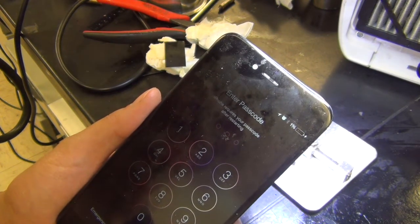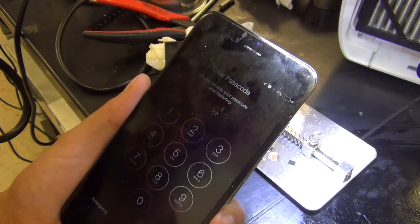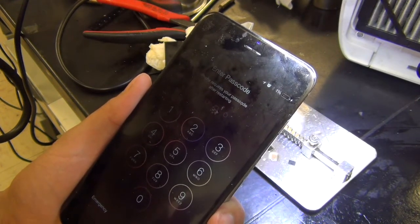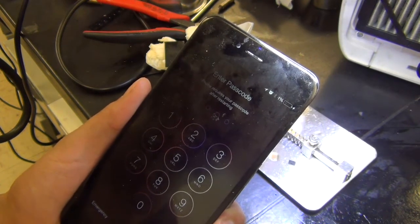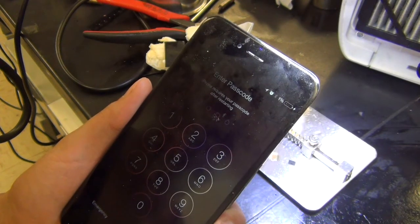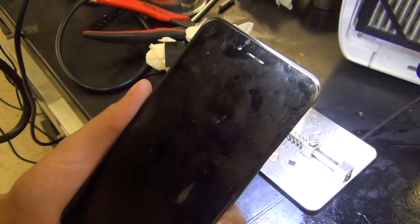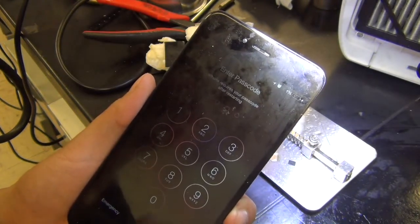Just don't keep your phone in a really tight case and don't overheat it by playing video games on it. After you replace the IC — at least in my case, because I used lead solder — you're not going to have the same kind of problem as before. It's not going to go bad again, as long as you use lead solder instead of the original lead-free solder that came with it. You just need to mix a little lead into it. Lead-free, mostly tin-based solder creates little microscopic whiskers that short out the chip. As long as you use lead solder, this problem shouldn't come back again in the lifetime of this phone — something else is going to break before that happens.